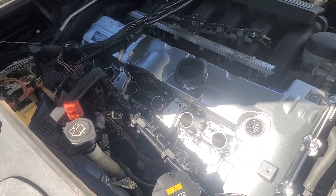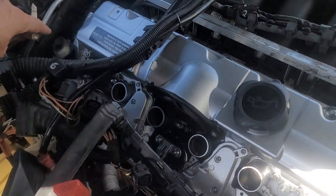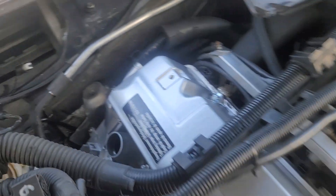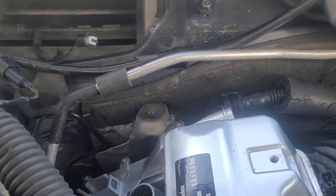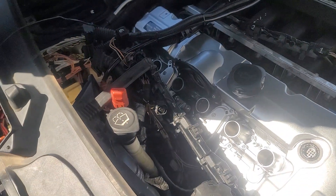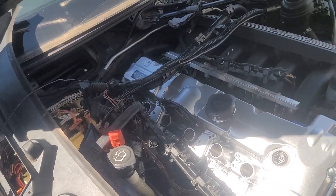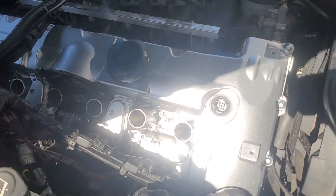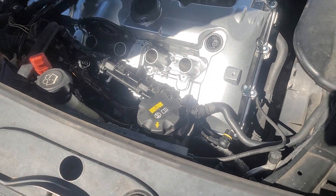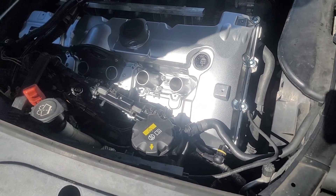The plastic one you can flex it and get around your AC lines back here in the back — you can see scarring on mine where it had caught several times. I had to pull every bit of the cowl out all the way up to the glass, because where the valley is in between the cams sits up high enough that you can't get it around the cams to even get it on the head.